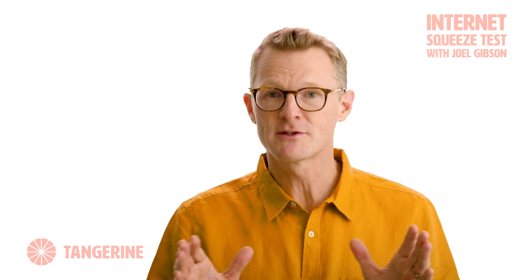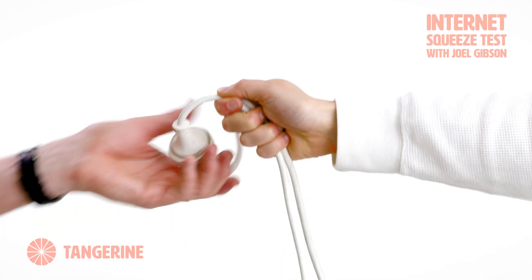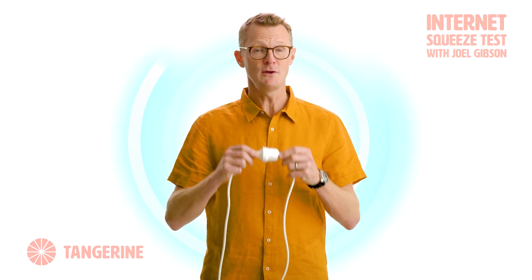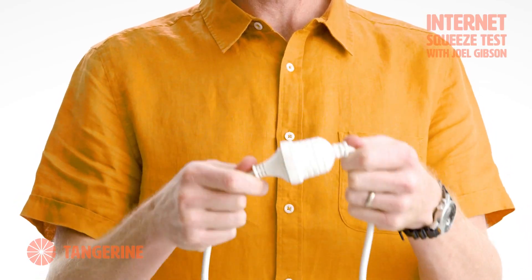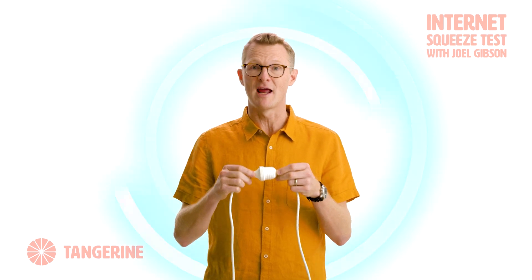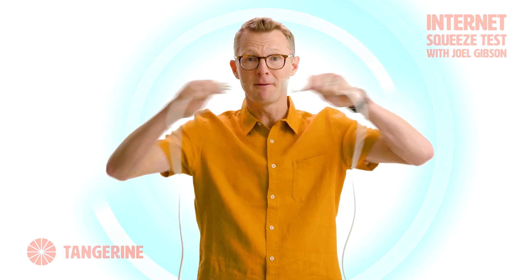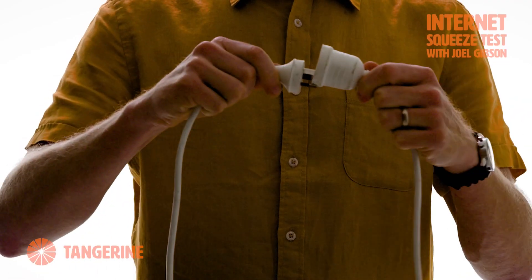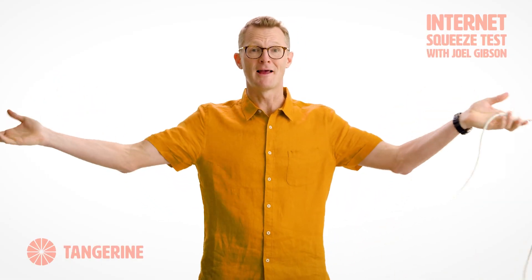Last but not least, and I'm sorry if this is a bit too technical for some of you, we're going to turn everything off and we're going to turn it all on again. Now, I know this seems dopey, but in fact, when you power cycle your NBN box and your modem and your router, it clears the memory, gets rid of any old jobs that are bogging them down, and selects the best channel when they start up again. So to do it properly: unplug each device, wait about 30 seconds, plug it back in and turn it on, and then claim full credit.